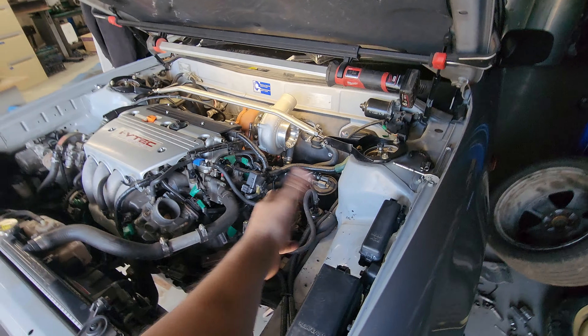I'll have to fix these manifold bolts later as well, but the turbo sits in a really cool spot - not really where I wanted but I looked at all the other options and it's definitely the best one. So it's been a bit of a minute - I've cut this one back, put a 90 on it, put a 90 on this one, extension, and then cut it all flat with the bandsaw. I've got some more bends which I've also cut down, so these will go on there like that. I cut this way which was actually quite tricky, and end up with this nice shape here. If I grab the gasket, we can actually fit that on there quite well and that squares us up with the manifold. The plan now is I've copied all of that onto here, so I need to cut that out, then I can weld that on there and bolt all this together.